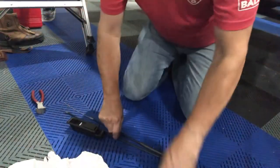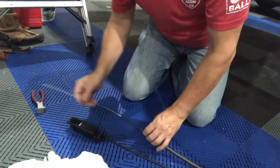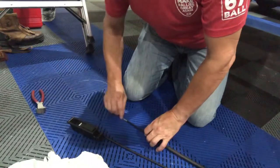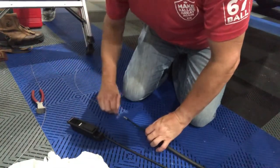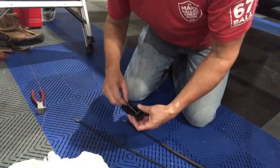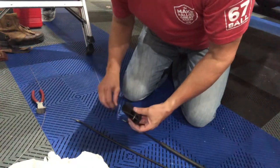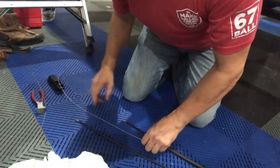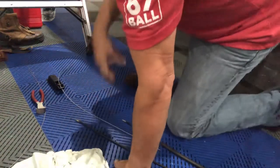Let me show you what we're doing here. The old cable is right here, the new one is here. I'm going to take the cable out of the old housing completely — it's all the way out. This has been greased, so I'm going to thread it through the new housing. It picked up some good grease on the way through.